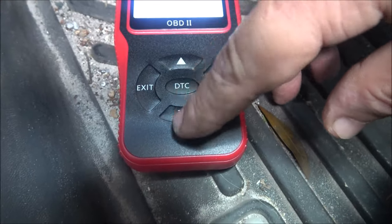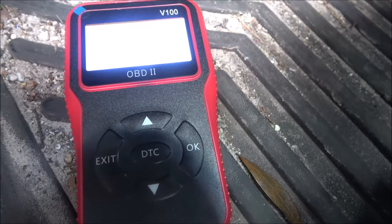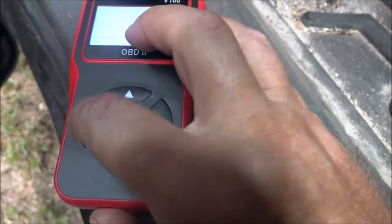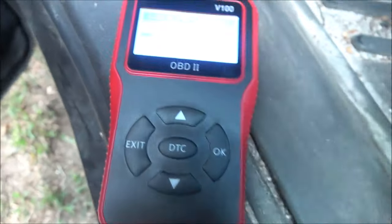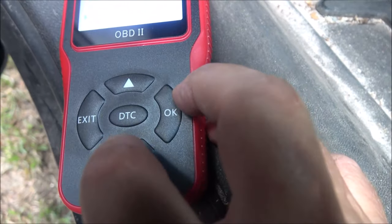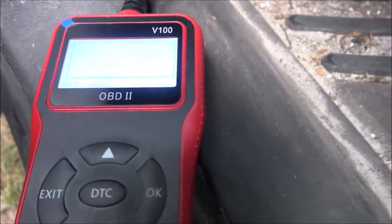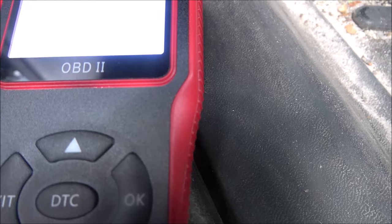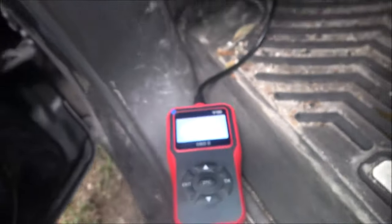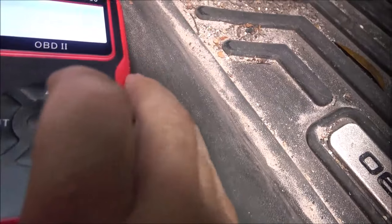Okay, so she just got home, so let's go to engine coolant temperature. It's working, it's 181 degrees, that's about right. So let's go to, all right, now let's go to engine RPM. So that's about right. We're going to call it around 600. And that's about what that's reading. So that's good. Now let's exit out of this.